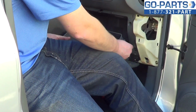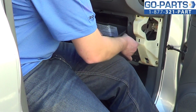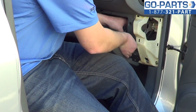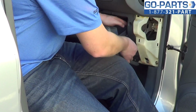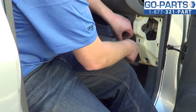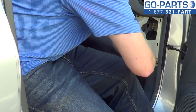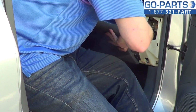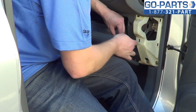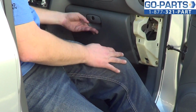First we're going to fit these two stoppers back into the rail. So with those back in place, take the small cable that helps ensure that your box isn't falling all the way down. Put the little arm through the opening there. Once that's through, you turn it sideways. Cover it up with the little sticky tape that it gives you. Now your glove compartment's back together.